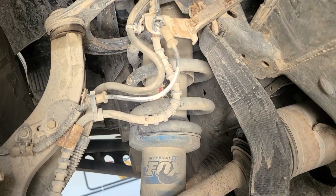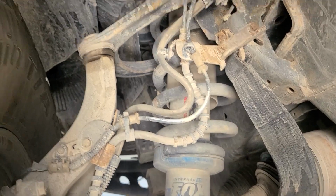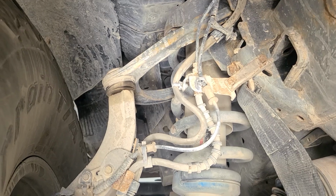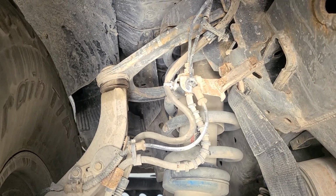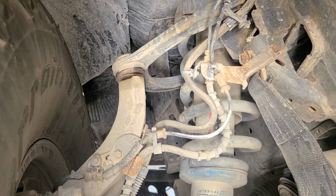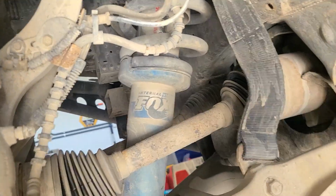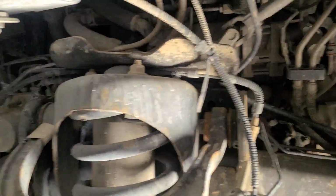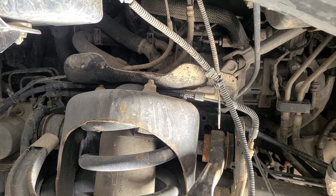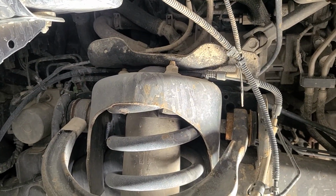The only thing is that the stock Fox shocks are a little soft, and they don't work quite as well. And then the upper control arms have a tendency to wreck the ball joints pretty commonly. I've replaced one arm on one side just through general maintenance and wear and tear. But other than that, people, don't think that you need to go crazy, especially if you're running much bigger wheels and you're putting the 2" by 2" fiberglass on as well, and running 39" tires. And the geometry is great.